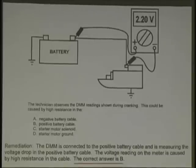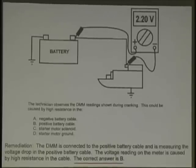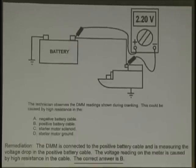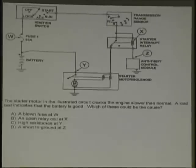Don't forget some of those starter motors on the Ford Taurus. You've got an aluminum bell housing, you put steel bolts through, what happens a lot of times? When you go to use your air gun, you take the bolts out, you throw a new starter in that's been painted like a Picasso, it's beautiful. You stick it back in, it works for a while. Then the customer comes back with a problem. You should have done a voltage drop test on the ground side, seen it was a problem, cleaned the area up with the whistle wheel, right? Clean the bolts up, put it back in, and you probably didn't need a starter. That's pretty common.